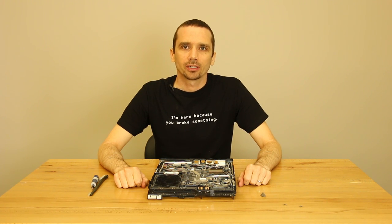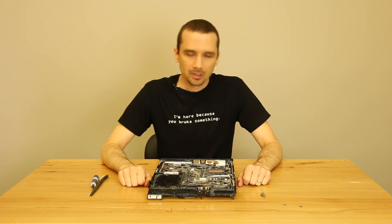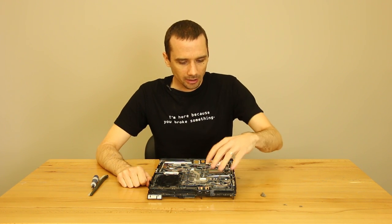Now you have an idea of how to clean out your PS4 really well, including the heat sink. Once that's done and you've cleaned out your fan, applied new thermal paste, and made sure your thermal pads are all in place, you should be running a much cooler PS4 — and hopefully that works out well for you. If you have any questions or comments, just leave them in the comments section below and we're always happy to answer them. Thanks for watching.